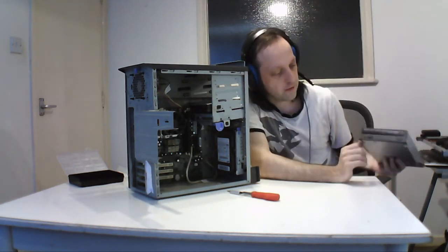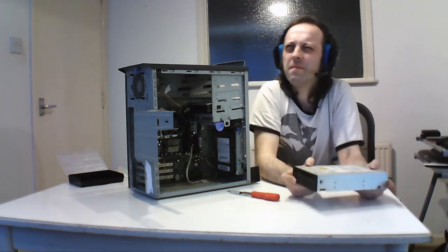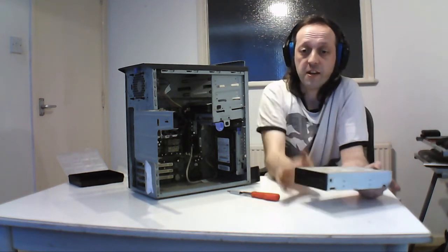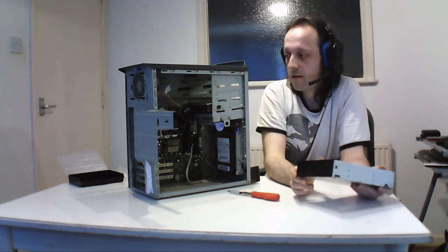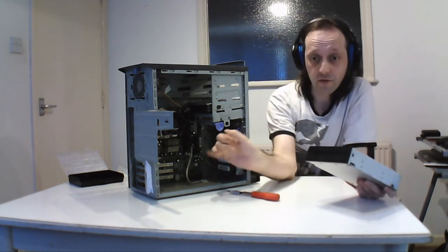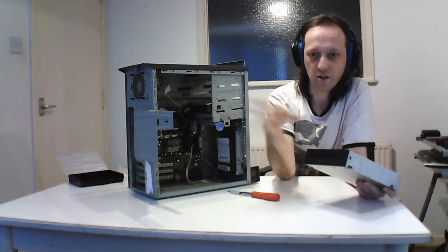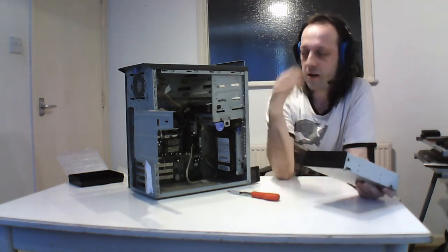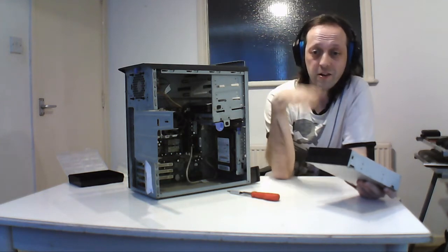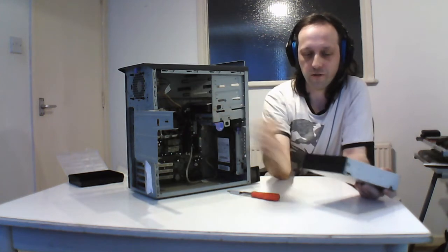Like I say about this, there's a little headphone socket and volume control. At the time, if you put a music CD in here, you could plug your headphones into it and use the volume, and that's what that little audio cable is for, so that the sound from the CD could go to the sound card. You still need to control everything from the software, but it was like a CD audio thing, designed to send the CD audio to the sound card.